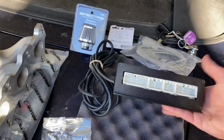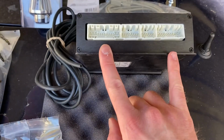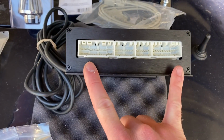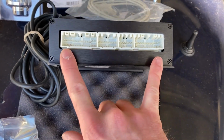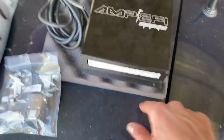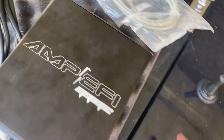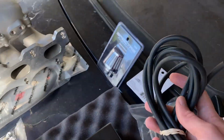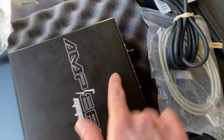Essentially, how you're going to be running it: your 96-97 ECU is actually behind the seat, and we'll get into that in a second, but both plugs I believe should go on the outside. I don't know if I'll be drilling holes into the body and mounting it, but we'll get there when we get there. This right here is your vacuum line, which is also why they have the tee-off. You have to run a vacuum line from your car to the back of this Megasquirt to provide a vacuum.